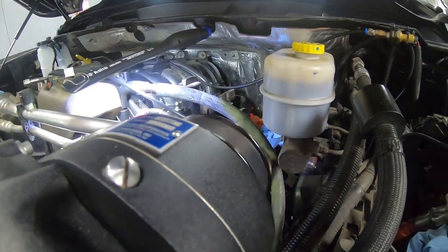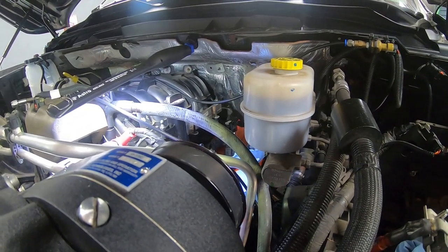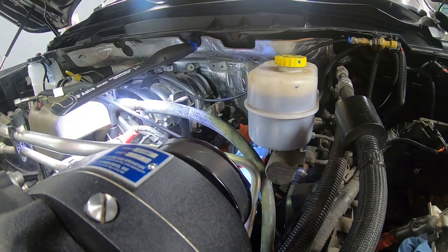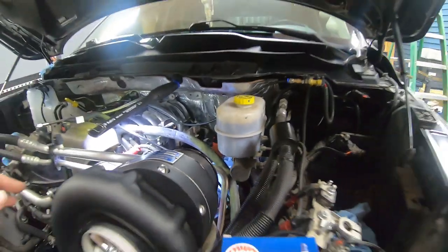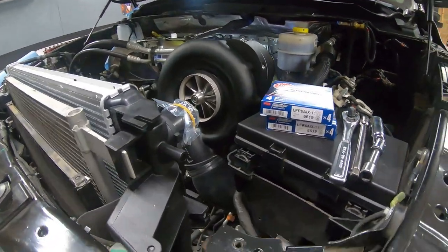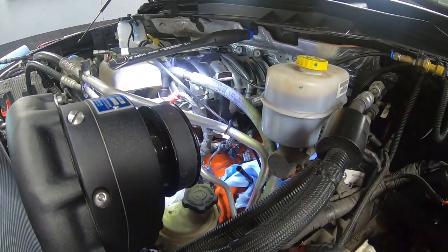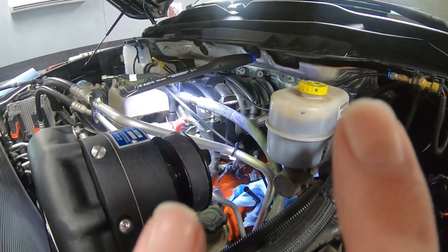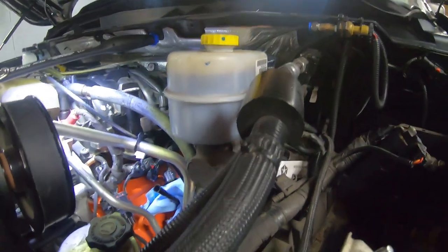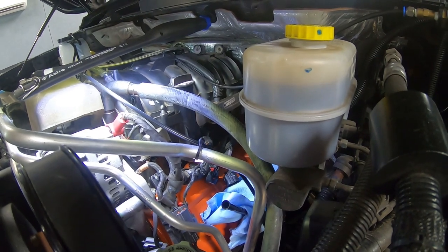So it's not only that, they also do it like a lot of engines do, not just the Hemis. A lot of them will have double spark plugs to provide a more clean and all-encompassing burn, basically trying to more completely utilize that air fuel mixture that enters those cylinders by firing 2 spark plugs located on opposite ends of the combustion chamber rather than just one in the center. It's pretty common practice, but just be mindful that if you're going to be doing this job on a Hemi, you need 16 spark plugs.